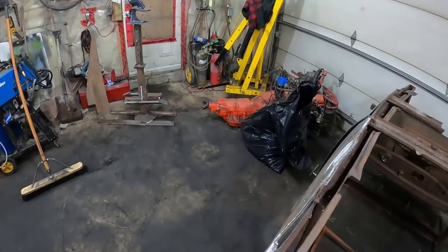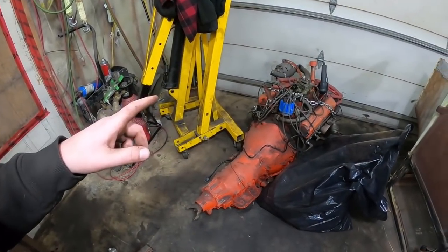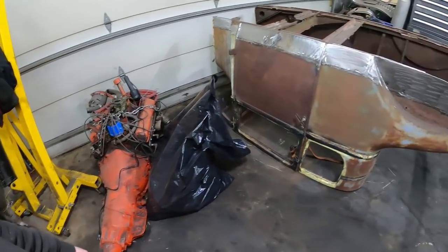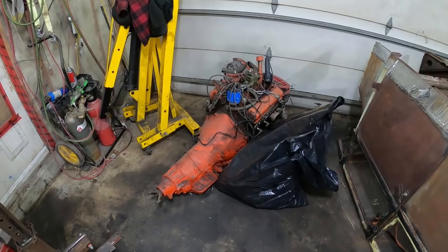On the motor, I put it up to the transmission, but the ring gear, the bolts in there were too long. I forget what I did there, so I gotta do that, which I think I got some fine thread bolts, and I gotta drill and tap the motor for that motor plate at some point.